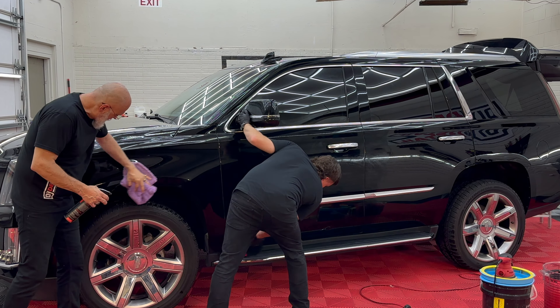This mirror is a testament to why you need a ceramic coating on a vehicle. We've cleaned it, we've polished it, we've done all sorts of things to it and the bug guts have etched into it — there's no way other than repainting or deep wet sanding, and maybe damaging it further, to get rid of those etchings. But from here the gloss is just outstanding — it makes me like black paint again. Now we have a glossy, shiny, attractive-looking vehicle. I think it's going to sell. We're going to make some money if we're putting it on the market — we're not the ones selling it, but I'm sure the seller will enjoy what we've done.